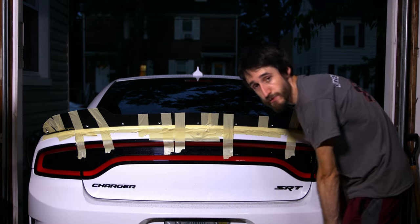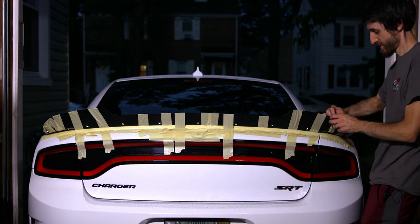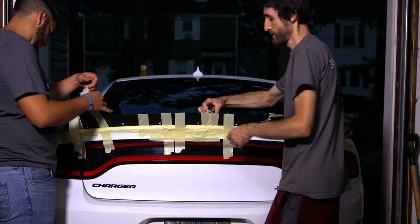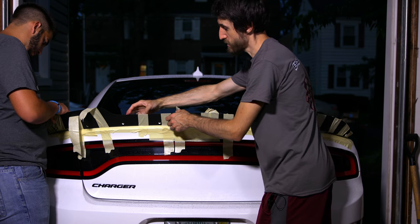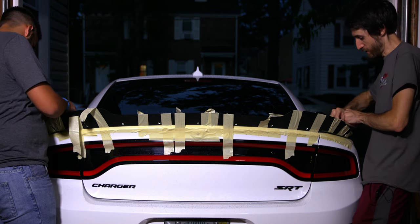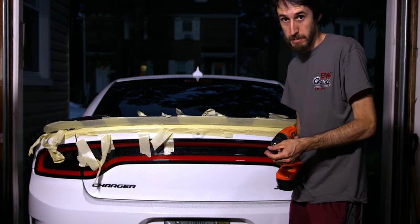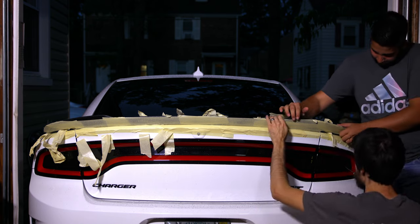Now it's time to remove the spoiler and drill our pilot holes. You can just rip the masking tape — you don't really have to make it perfect now. After you drill your holes, then you can start making everything straight. I highly recommend using masking tape for this job and not another kind of tape, because it'll strip vinyl and could strip paint. I always use 3M — they make really good painter's tape. Make sure it's a 7/64 drill bit; you don't want to go any larger to drill a pilot hole. The masking tape will prevent paint chipping and prevent destroying your vinyl.